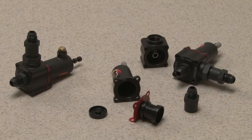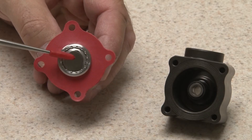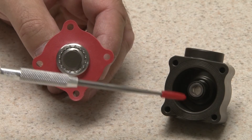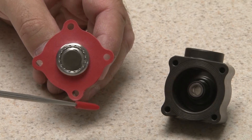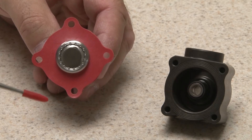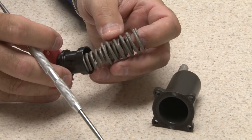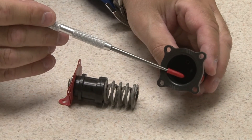It has many unique features. A self-centering live action pintle provides superior sealing. The pintle and the seat are micro lapped and polished for a bubble-tight seal. The springs rest in a carrier that travels in the tower, which has a polished bore for smooth movement.